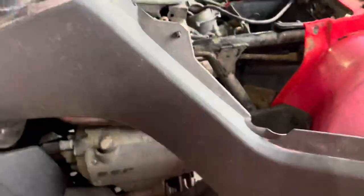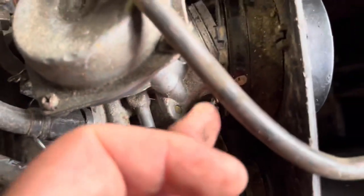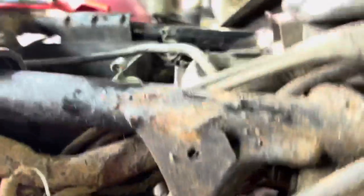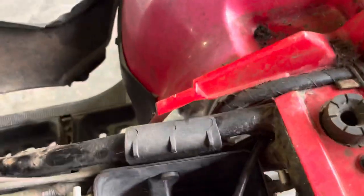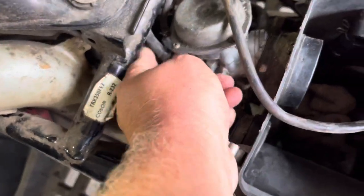The first step is getting all this plastic out of the way — I just popped it a little bit. You've got two clamps back here, one right here, one that goes on here, and one on the front. Take those off, then take the fuel line off. On the other side there's a black cover — mine was already off. You pry it up, and that little cable goes in there. Then we take this off here, which I'm thinking is a half-inch — nope, nine-sixteens.